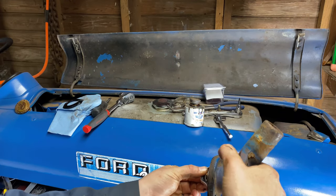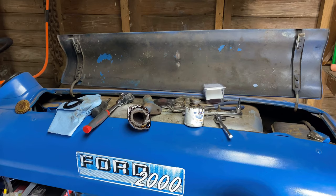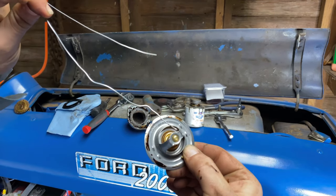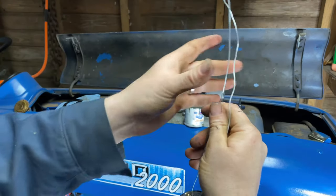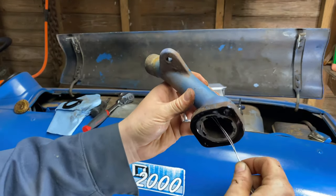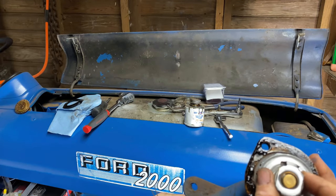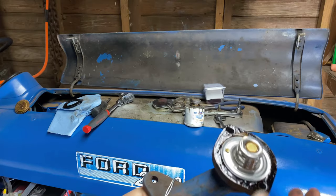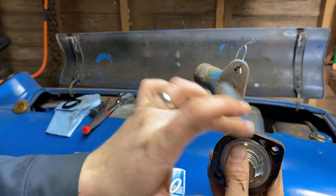Because this sits mounted vertically on the front of the engine block, sometimes it can be hard to get it to stay in place. A little trick — get a piece of wire, maybe a foot or two long, run it through the housing side of the thermostat halfway, and straighten it out. Then run that wire through the housing and pull it on through. You can position your thermostat where you need it, hold it tight with the wire, and once done installing it just pull the wire out. That way it stays in place while you're installing it.